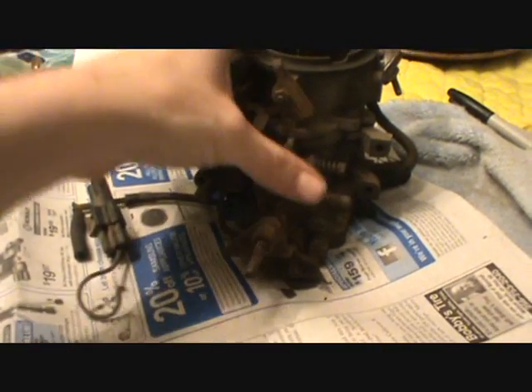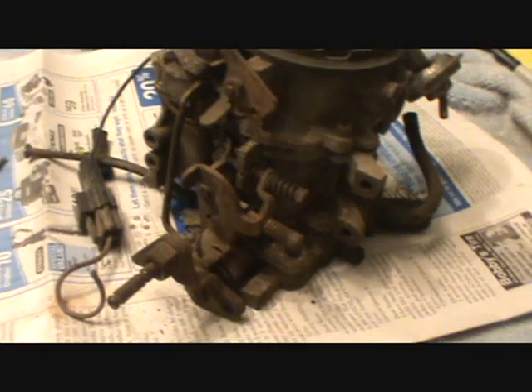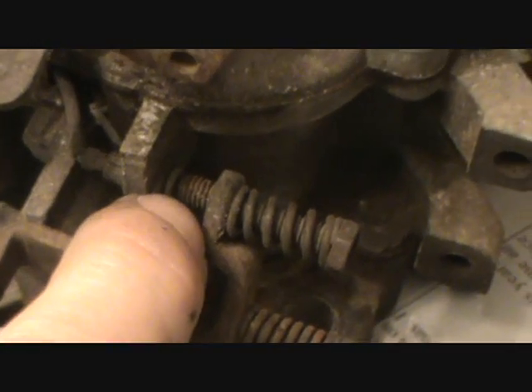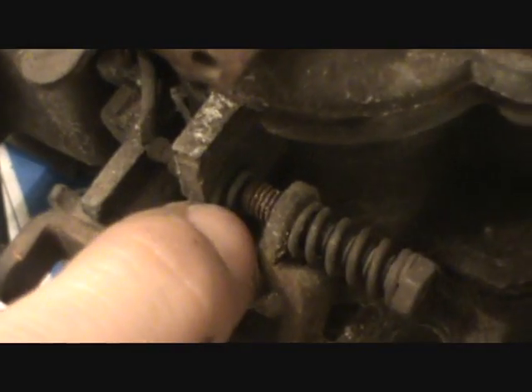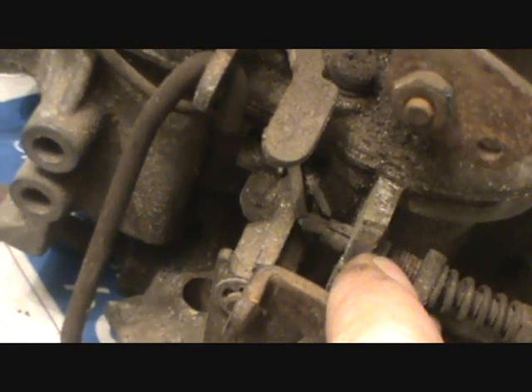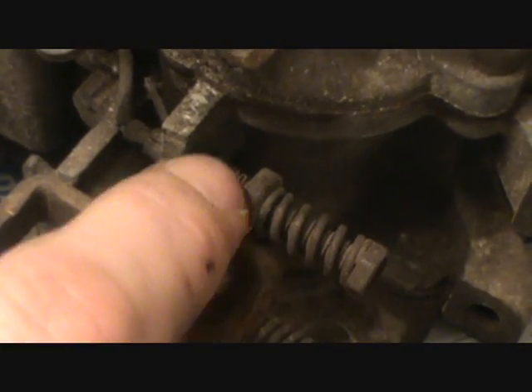What I'm using to make this simple is I've used this Carter BBD, one of these pieces of shit, to illustrate how a lot of these look. Now, this one has two idle speed screws on it. If you see this top one here, see how it just goes directly into this little nylon button? That actually does something else on the other side, but we don't care about that. So that's just a switch. Essentially, you see it just stops — that's your base idle screw. That's where it sets your idle when it's warm.